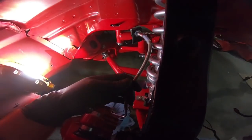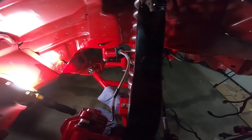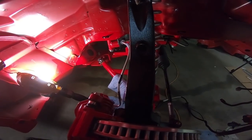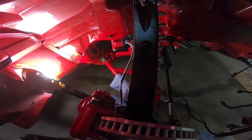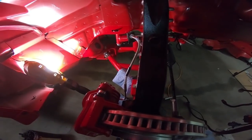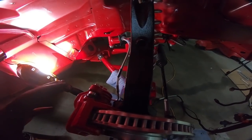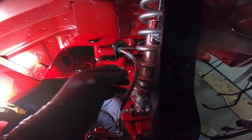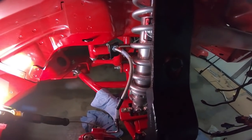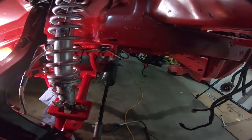These aren't the stock lines. BMR makes their K-member and A-arms around the stock setup, so running these lines they may be just a hair shorter. I don't have any binding right now side to side. The only thing I'm looking at is it's close to touching but it's not actually touching — we're going to wait until the suspension is loaded. So let's move on to the inside — this is going to get real fun because we're going to have to bend a lot of line. We got really lucky on this side; there wasn't a whole lot to bend, but there will be in the center.